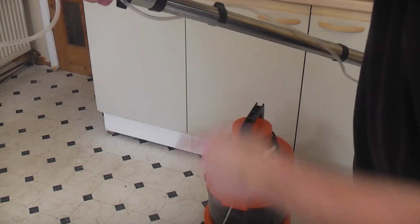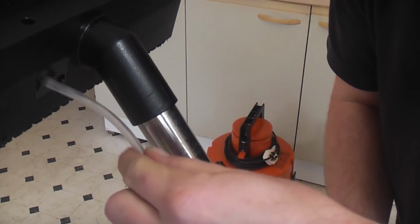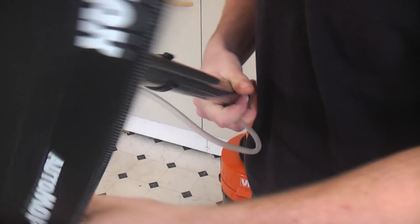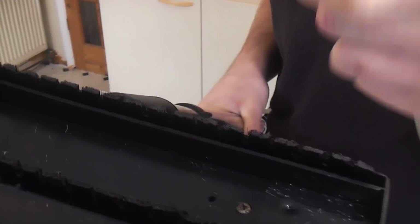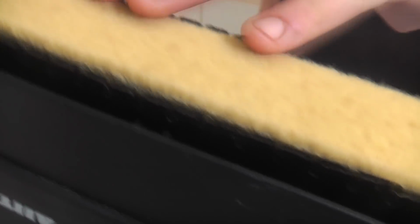So I've got the solution tube run the same way as when we wash the carpets. However, I'll try and show you this. Let's come down to here. To put it on the Automop, there is a hole there, which works exactly the same way as on the wash head. The water simply trickles down the tube and comes out of these 2 holes and basically just gets this sponge really wet. Then these are the normal combination tool style brushes, with the same stiffness. They provide a scrubbing action and this sponge is quite agitated as well.